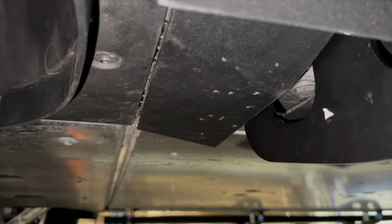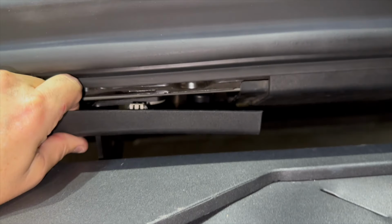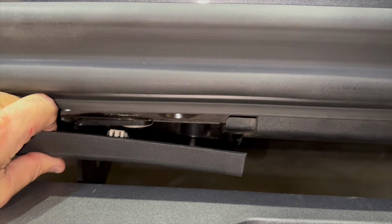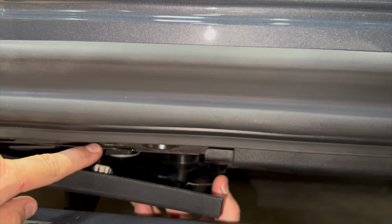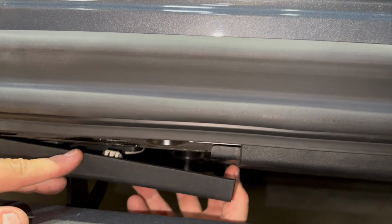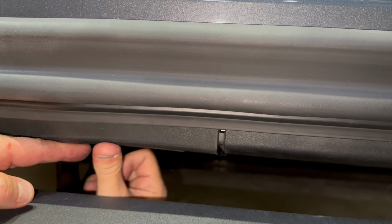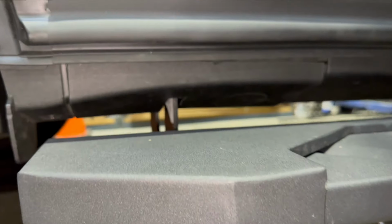Okay, now we're going to slide these two pieces in. I want to show you a little better view underneath. And now we're up on top. And we're going to hold it right there. Perfect. Now this grommet, just bend it. Make sure it's going straight up vertical into this slot. We open the door up, so this makes it a little easier. See how it goes straight through. And then locked in. And now underneath, we're going to tighten the screw on that recessed hole.